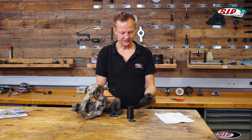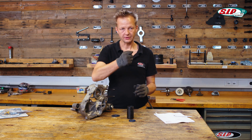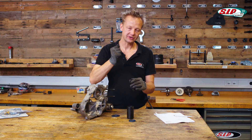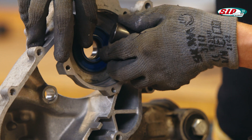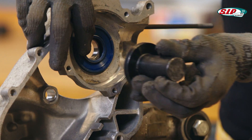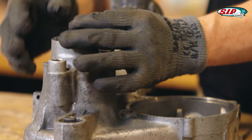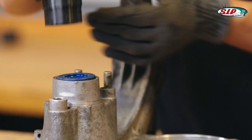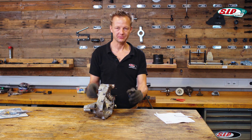I will use the SIP punching tools, but we're going to go to a drilling machine and use it as a press to push down the rings inside. This one is the main oil seal on the clutch side, and this one is for the brake drum. Now we're going to go to the machine room and press it in.